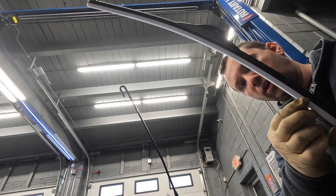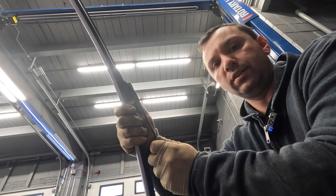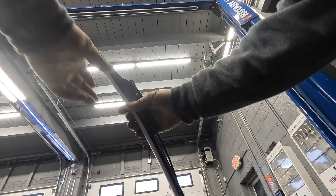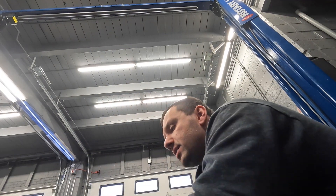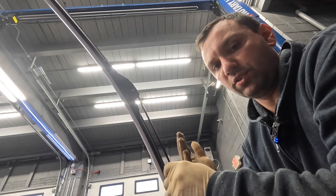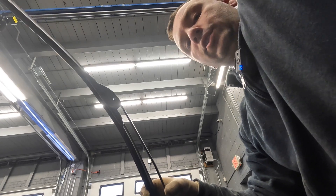We are upgrading this to a flex blade — I love these flex blades, they conform to the windshield. This white part is actually the protector; you're supposed to remove it after you install it. I go ahead and line it up and push it into place. It's kind of hard because you really gotta get this clip plugged in. After I hook it on there, I'll just lower it and snap it in. Slide it up until it pops — once you hear it popping, you're good.